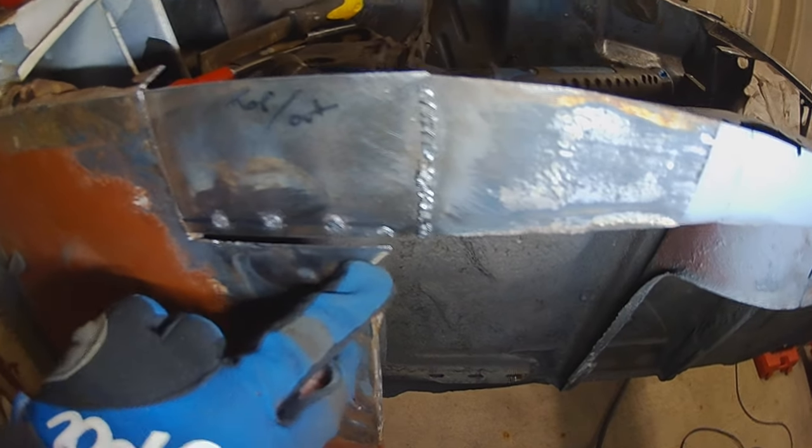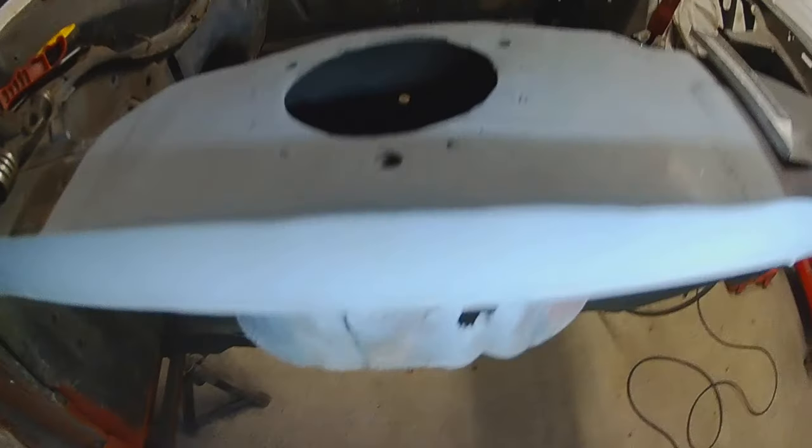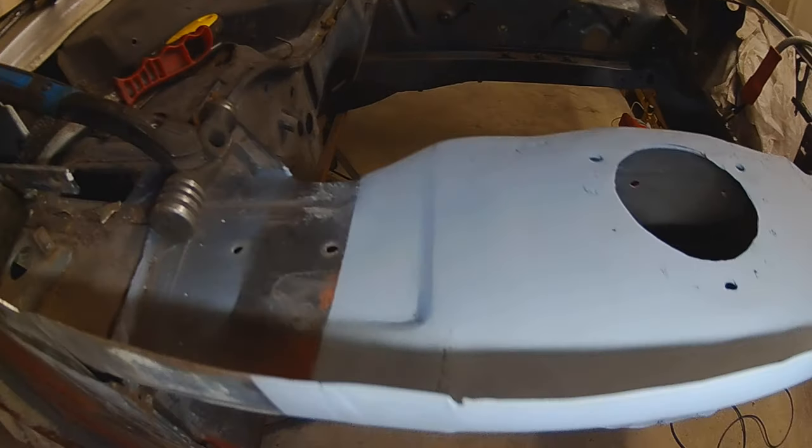I'll just crack on with this next bit and I'll bring you back in on that and look at the repair piece before it's fully welded. You know what, I might leave that as a gap because it was originally a gap, but if I seam weld it then the water will never get behind there again. And obviously I've left holes in it to spot weld it to the inner plate, and then it smoothly gets welded into this piece here. So there we have it - one strut top repaired. Nice little panel put in here, nice little panel put in there.